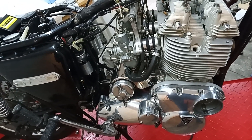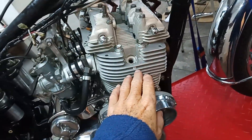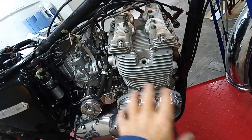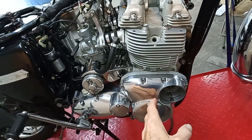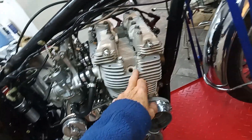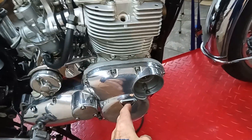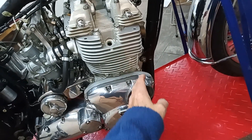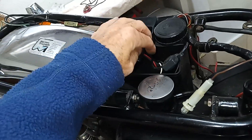We're going to put the engine to top dead center, then turn it backwards to get the timing mark to fully advanced before top dead center — that's how you start fitting the ignition. Once the engine is set to fully advanced on number one, we'll fit everything according to that, run the cable around, then connect it to the black box and check the wiring from the black box.